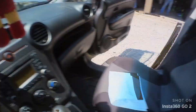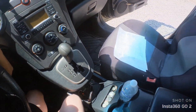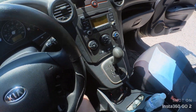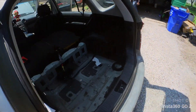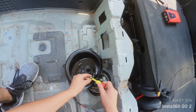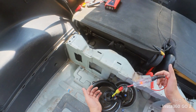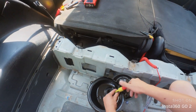As you can see, there it is. I still don't have light there. Let me double check here because somehow this moved — let me make sure I have a good reading. Always check your connection because you could get bit by this. Always seal up your leads. As you can see, a minute ago I had no ground, and now I do have a ground — I had a bad connection over there.